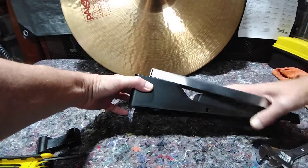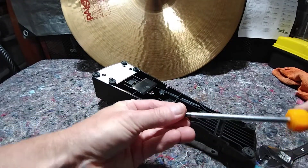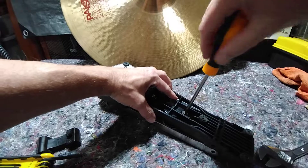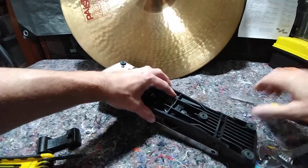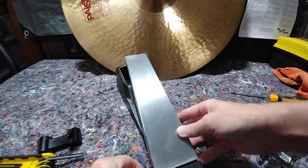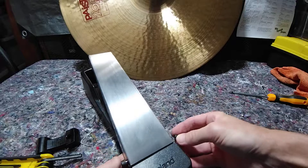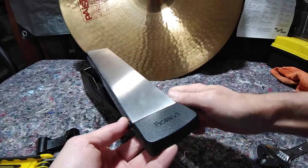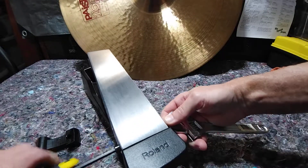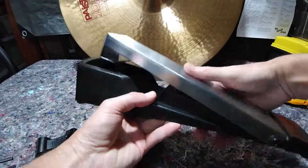Let's get this back on the foot pedal. Make sure the tab is in there, lock it in — this is a bit fiddly. There we go. Once you've done that, you can put the wheel screw through, secure it in place with the foot pedal, screw it on, and lock it into place. There you go — that's it. The new one is installed.